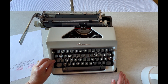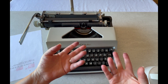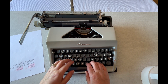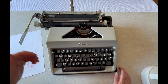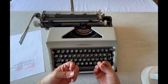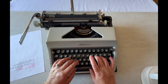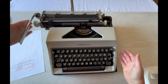Right here is your tension selector, and that determines how hard your type bars are going to strike your paper. The other way to adjust the tension is with your fingers as well. My husband has a very heavy hand when he types — it feels like he's going to type right through the table and through the floor and into the basement. I have a very light touch, so we would have different settings for this. I personally don't see a lot of difference, but the more you type, the more sensitive you get with your keys. That's probably when this tension selector will become beneficial — as you really get to know your typewriter and can feel how to adjust with your fingers.